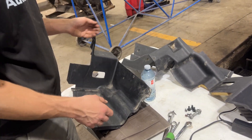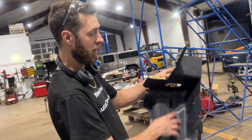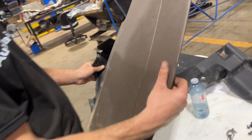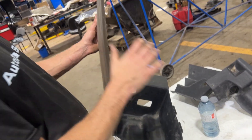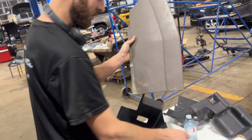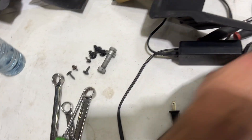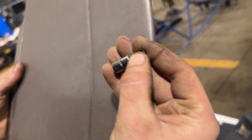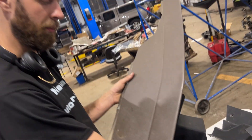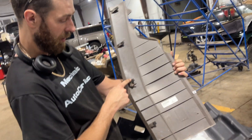Once you get that off, the tricky one is above by the gas pedal and the brake pedal. In order to get this out, you have to remove this side trim piece that sits up against the whole center console with the radio stack. I found two screws here — little Torx screws, T20, or possibly T15. T20 seemed to fit but they seemed a little worn out. Once you take those screws out, this whole piece just slides out. You can see a bunch of clips — use a trim tool or screwdriver to get in behind and pull it out.